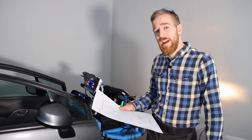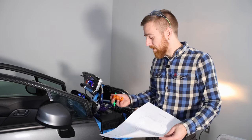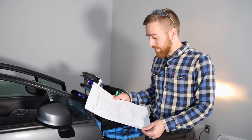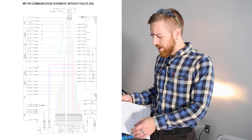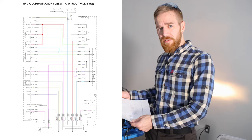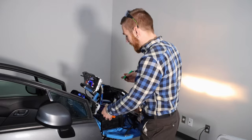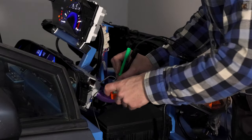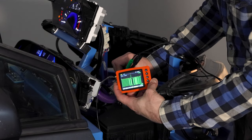Another very important aspect of diagnosing and learning how a multiplex system works is oscilloscope use and reading electrical schematics. With the product comes an electrical schematic with all of the modules and all of the CAN buses on one page, as well as all the test points. So you and your students can easily go in and pull up a pattern at any point in the CAN bus — it's that easy.